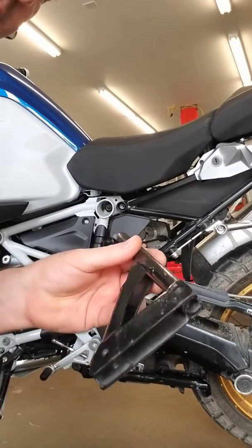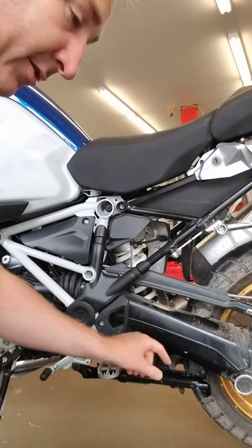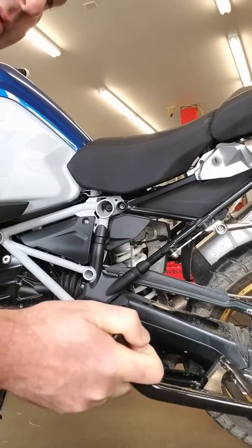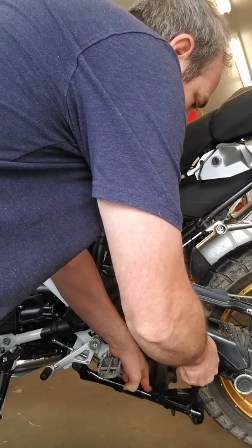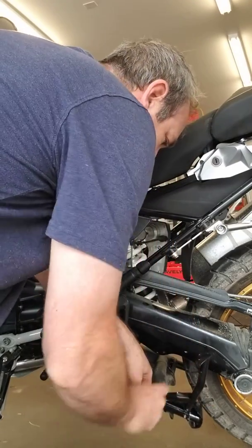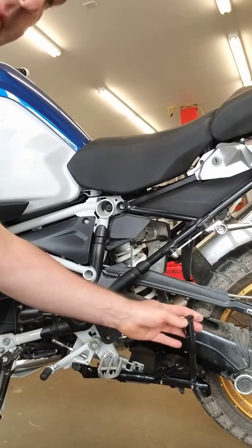And basically I have this removable arm that I carry in my luggage. And I welded two channels on here, or two pieces of plate steel that this slips into real loosely. And I pull it out when I want to put the bike on the center stand, pop it in there like that, and I just pin it with two bolts. Not a big deal. I mean, take 20 seconds right there, boom. Now I can put my bike on the stand.